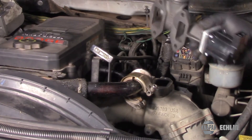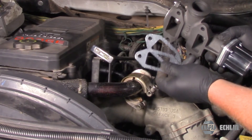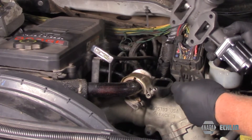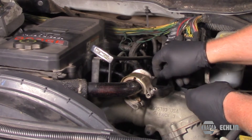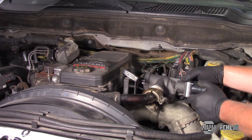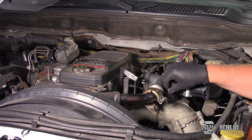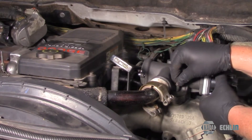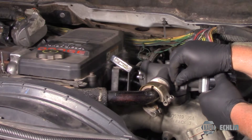So I've got my new valve. Fortunately, this came with some new gaskets. I'm going to put the new plenum gaskets in place and set my valve in place. I'm going to take the four mounting bolts and start them by hand — I'm not going to run them down tight yet. I'm going to make sure that we get everything properly lined up.